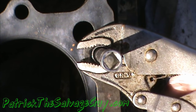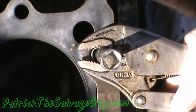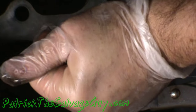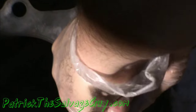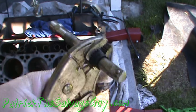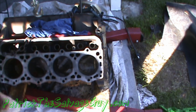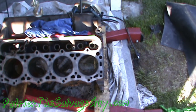Clamp your vice grips down on the dowel, smashing it against the extension. Now don't just start trying to pry it out — first start turning it. It's not really that hard to get out. Once you've gotten it loose, you can then just pry it and there she is. That's what you're doing right there, and that's how big the dowel is — it goes in the 7.3 liter Power Strokes. Just take the vice grips off and it comes off.